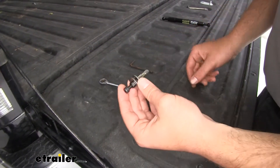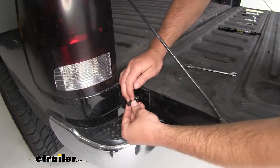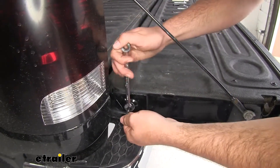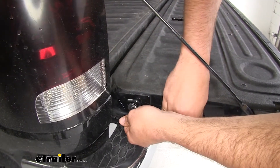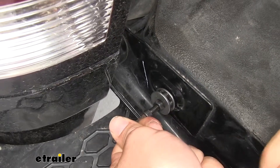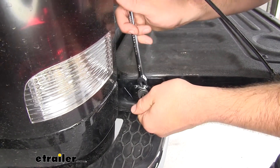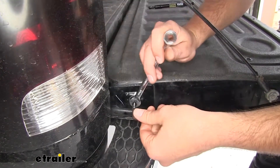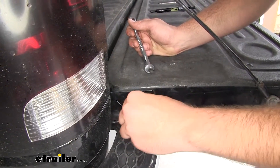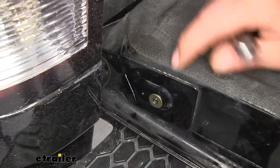After you've let this sit for about an hour, you're going to take it, insert it in this hole right here in your tailgate — just push it in. Insert your Allen wrench and turn your nut, holding your Allen wrench still, about nine times. Once you feel that you've had it tight enough, you can check that by taking your Allen wrench in the bolt and wiggling it back and forth — you'll feel that the fitting is solid. Then take your wrench, go the opposite way, and loosen up this nut. Then remove your Allen wrench. Take this bolt out and you'll see what's left is that nutsert.